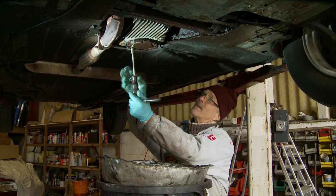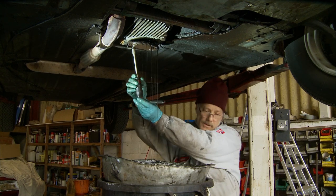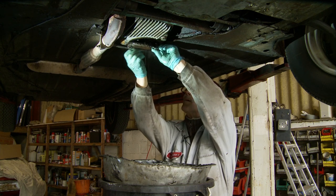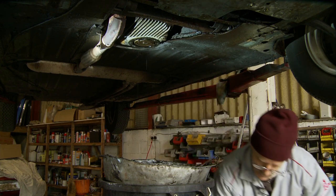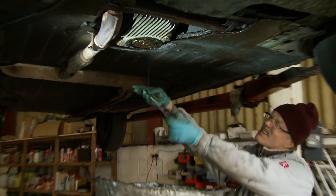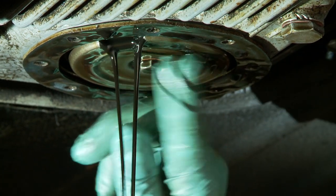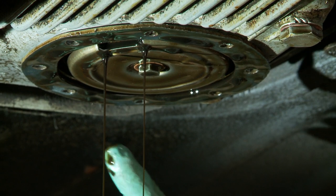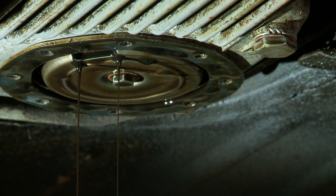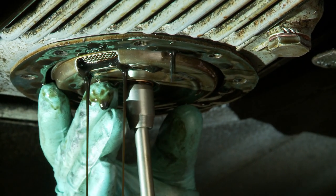If I slacken off the last bolt slowly, I can control the amount of leakage. Now the main bolt in the centre of the oil filter is 12mm — Citroen in their infinite wisdom changed it so it's different from the ones on the filter. There is a little metal triangle stamped into the bottom plate of the oil filter and a triangle cast into the sump, and those need to be aligned. That sets the position of the oil filter and that is vital — it's important when you're putting it back together again.